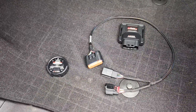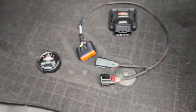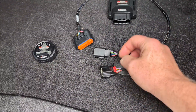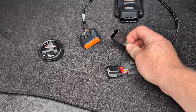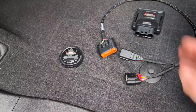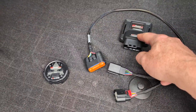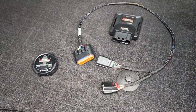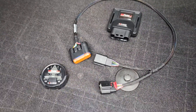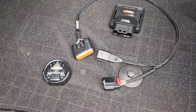The basics of this install: you unplug the pedal. You'll notice there's a plug at the top — you plug this one into the pedal, you plug this one into the original harness, and then this one plugs into the box. Really all you're doing is intercepting the signal, running it to the pedal, and then that runs back to the engine. This one tells it which map you'd like to use, and that's it. It really is just a simple install.